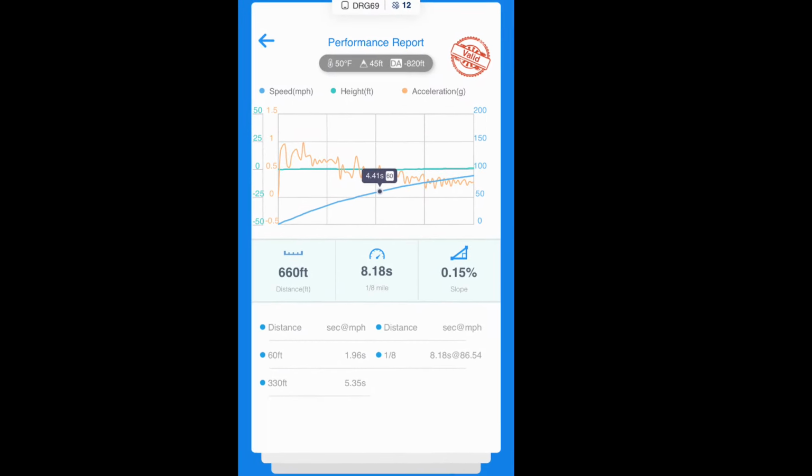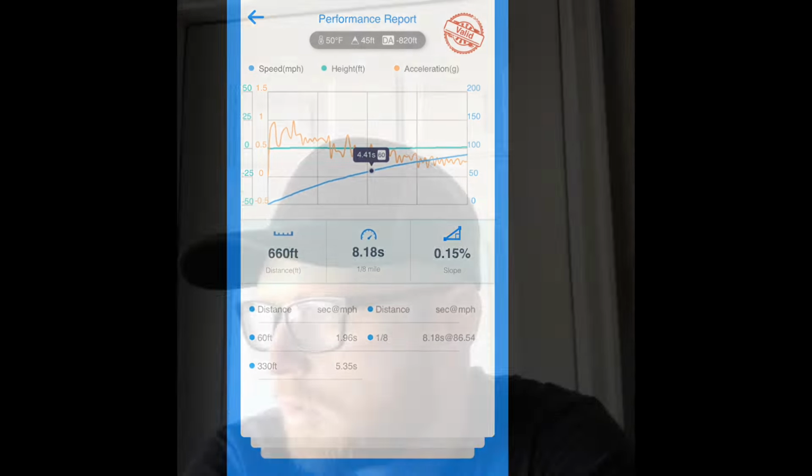And it doesn't spin at all on the street, as y'all saw, and it hooks good. It actually does mini wheelies. The best I could get in Mexico was an 818, I believe it was. I'll put a screenshot. Seems like it lost a little bit of mile an hour, but that's kind of to be expected, going from 373 to 410s. Looks like it lost maybe a mile an hour to a mile an hour and a half, somewhere around there. I think I'll be able to get my 799 naturally aspirated Friday night if everything goes well.